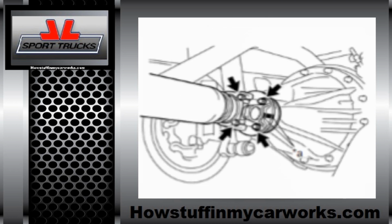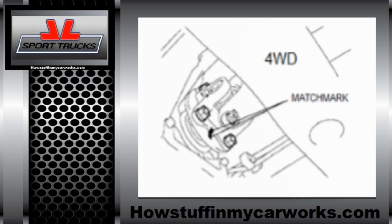Align the paint mark of the drive shaft and the differential and install the 4 nuts and bolts and leave them finger tight. Next, tighten the bolts in 2 stages. The first one, tighten them at 40 foot-pounds, and the final step, 65 foot-pounds. If your truck is 2-wheel drive, you only need to do this at the rear axle. If it's 4-wheel drive, you need to do this at the transfer case also.